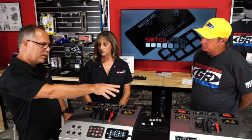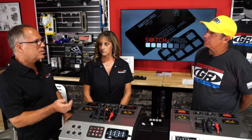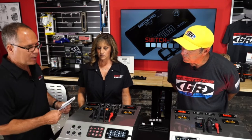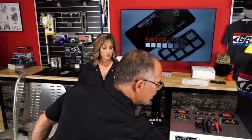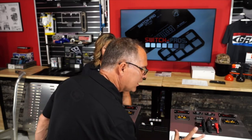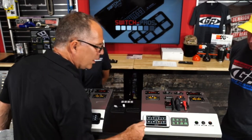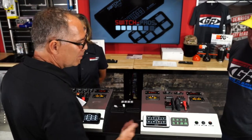The system can work with temperature-controlled fans. The SP9100 has two trigger inputs and the Racer Force 12 has three trigger inputs, programmable as active high or active low. You take the wire off your temperature switch and hook it to the trigger wire — when the temperature switch trips, it turns on the corresponding output. The nice thing is that's your automatic function, but you can also override it manually. For example, if you're doing a river crossing and don't want the fan running, just turn it off manually.